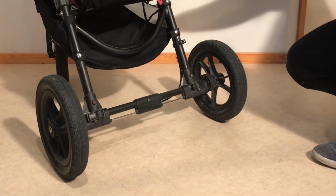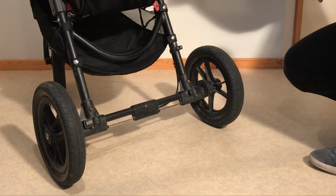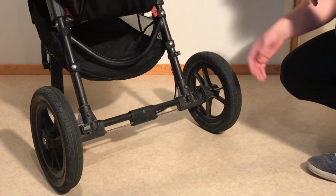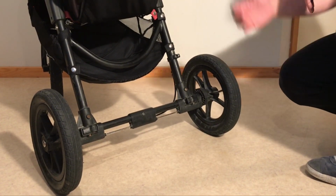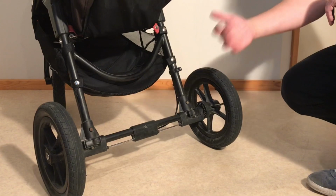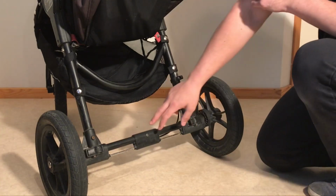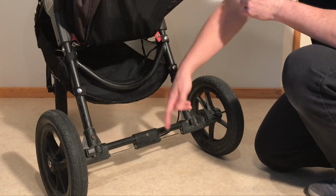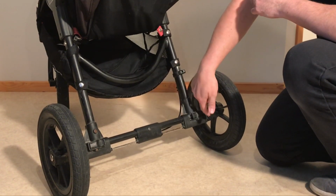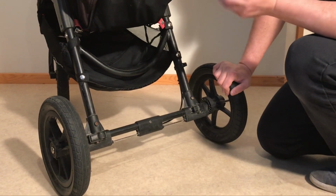Okay, we're going to move on to looking at the back end, and one of the key features of the back end is of course the brake system. The City Elite originally had a foot brake system, which was a little bit simpler and had fewer problems. It did sometimes have problems, but fewer. In general, the handbrake system is not horrible, but I've always felt that having a static handbrake produces unnecessary complexity, and you do sometimes have issues with this brake system, in particular because the brake element activated in the middle sends these pins all the way out into the wheels, and there's a long series of shafts and springs involved in getting the pin to eventually go in the wheel. So you can have issues with rust and grit, and definitely a need for lubrication.